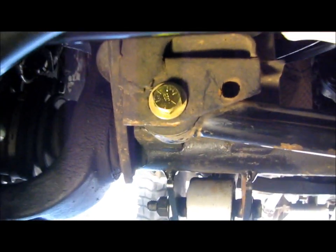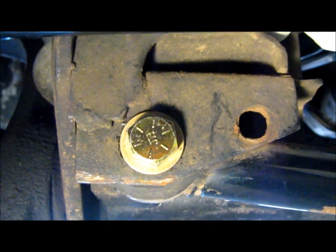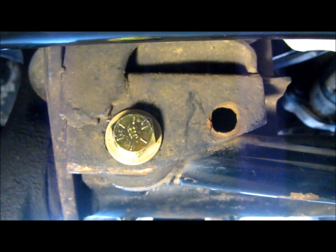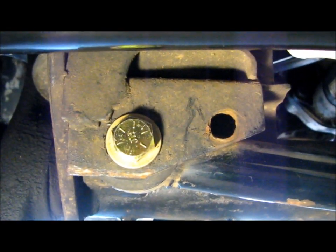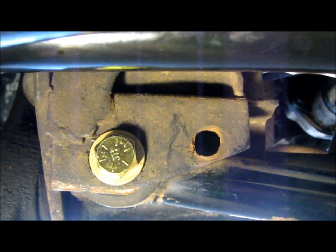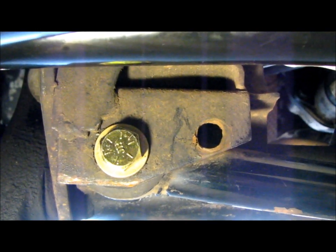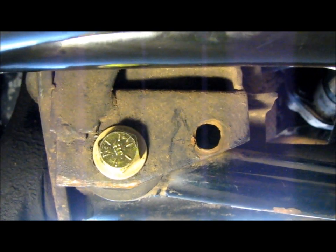Here's the finished result. Got the half inch drill bit in there and drilled straight through. What you want to do is have someone sit in the Jeep and turn the wheel until you can tell that the sleeve inside the track arm bushing is dead center with the existing hole. Once it was centered, I had her hold it in place with the Jeep running. If it needs to go up or down, just tap it with a hammer. Then fire up your drill with the half inch bit and drill all the way through the mount front and back and through the sleeve.